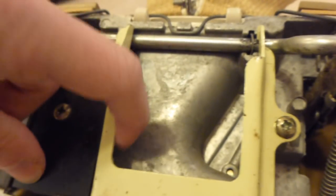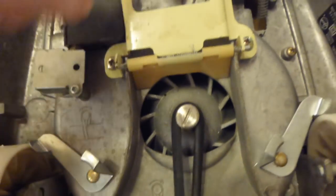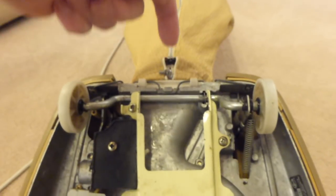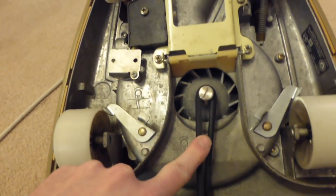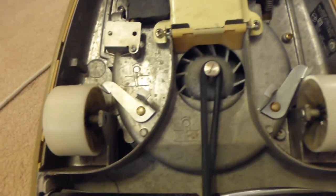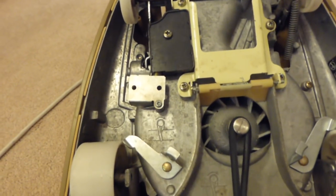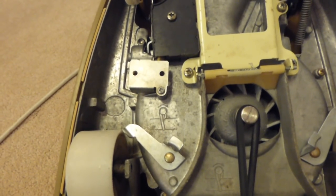It's a 2-speed model, this is basically. When you shove the tools into the back, this little speed switch here used to click on and then increase the motor speed, because of the converter, in America these are called convertibles. You used to convert them into a hose by sticking a converter in the back here, which would only partially cover over this spindle, because the belt stayed on. So the converter wasn't able to cover over this part because the belt was here, so consequently some of the suction used to leak out through here. That's why they weren't very good with the hose, and I've never bothered getting a hose kit for this, because the Seniors weren't that good. I think the Juniors were about as good as the Senior for hose suction, even though they were only 250 watts. But there we go.